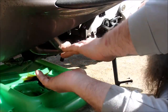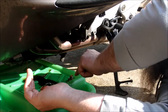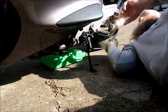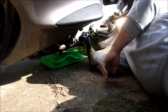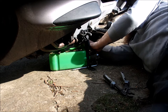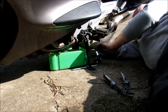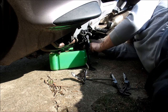With the bike on its side, it's released obviously more oil, so we're just going to capture the rest of that, then put the drain plug back in and take the filter out. For this I'm going to use this filter removal tool — I don't know how it's going to be with the space I've got but let's hope I can get in there. Well, that was slow and painful — but that's the oil filter. I'd buy the top-strap type just because that was a pain.